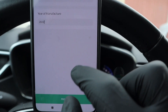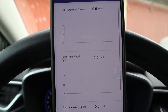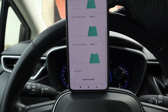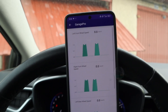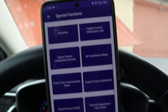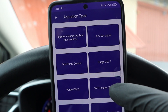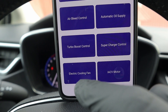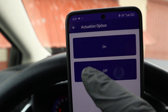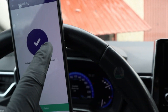Now let's check special functions on the Toyota — select specifications. We got something: ABS wheel speed test. Let's try moving a little bit to see if it is working. One wheel is giving slightly different data, which looks weird because they should all be the same, but I'm pretty sure I don't have any ABS problem. Let's try another function — actuation, which should be bidirectional testing. Let's try the electric cooling fan: ignition on, engine off, shift in park. Actuation reset has been completed, but I don't hear the fan turning, so it wasn't able to turn on the fan.